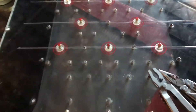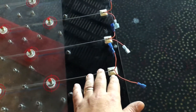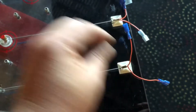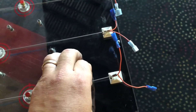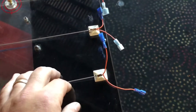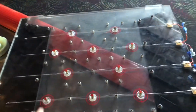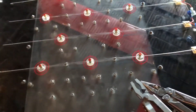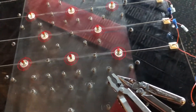The playfield is done and everything's been changed. On the last pin I was replacing, as I pulled it apart the wire broke off, so I had to re-solder everything back together and re-strip the wires to make a good connection. That's probably why I was getting a pin sensor alarm — it was a bad connection that would vibrate just enough to lose contact and throw an error. Now that it's all back together with all the pins in, I'm going to take a blower and blow everywhere I can to get inside. You can fully disassemble it, but it's a pain, so I prefer to just blow everything out.